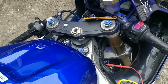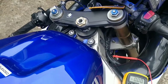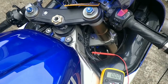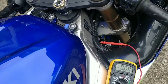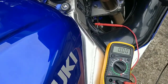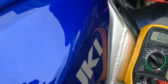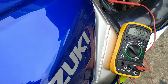So I'm still looking at the horn on this bike at the moment. Now, a friend of mine who's an electrical guy with motorbikes and mopeds, who can also help people out, by the way, if they need any help with their bikes, just contact me through this channel. He said to check the wire using a different live, which makes sense. The live down here, the black one, puts like 0.2 volts or something silly through the bike when you press the horn. We saw that last time.